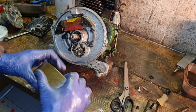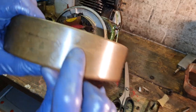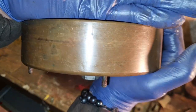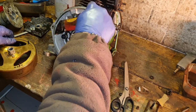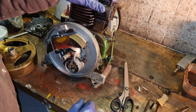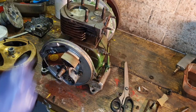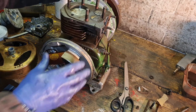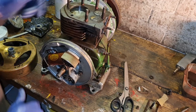We want our little mark. Where's our little timing mark? There it be. Look, see a little arrow on there? Can you guys see that? Little arrow there. That's got to go to the top. Dunk onto that little arrow there. Look, there's a little notch. The arrow needs to line up with that when you are just before top dead center.